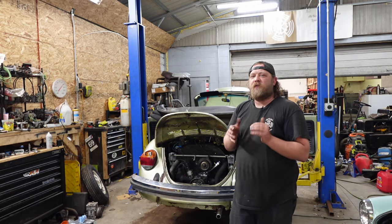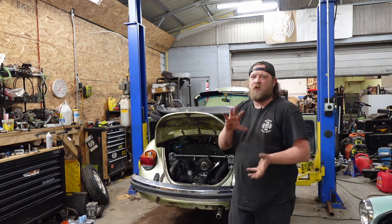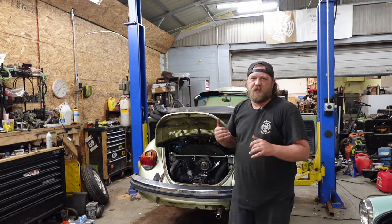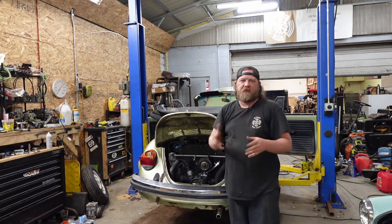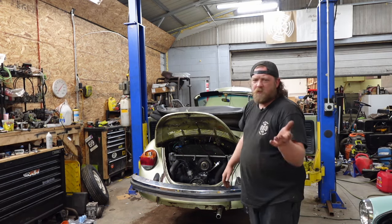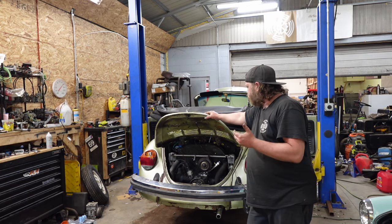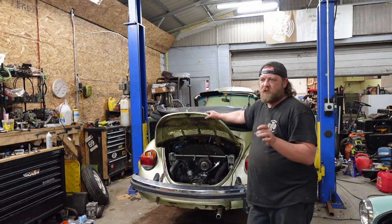If you have a locked up wheel, if you crack the bleeder valve and it sprays and then it moves, 9 times out of 10, it's your soft line. Your soft line's not flowing both ways. It's basically pushing through and then it doesn't have the pressure to go back through the constriction. Like arteries, mainly mine, I'm fat. But it didn't do that, it just dribbled out. So I'm thinking the wheel cylinders are locked.